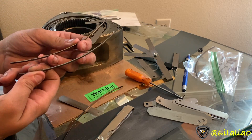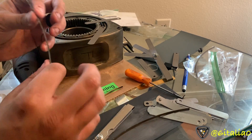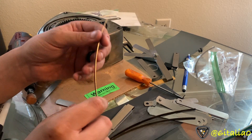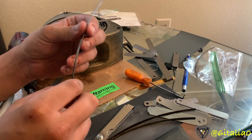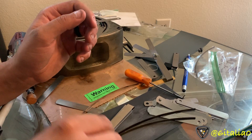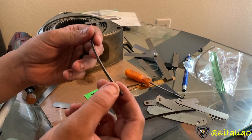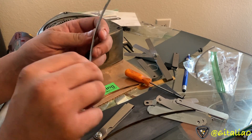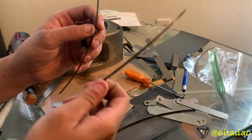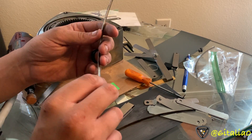It's about the same thickness as the outer piece of the Renesis side seal. Then of course you have the '86 to '02 — it's a lot skinnier and a little bit thinner than the older ones, used between '86 and 2002. Then you have the Renesis side seal, and it's somewhat of a combination of both: on the outside it's thicker, but on the bottom side that goes into the rotor it's skinnier, about the same thickness as the '86 to '02 side seal.